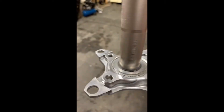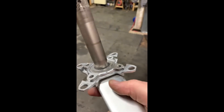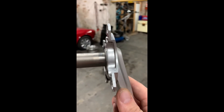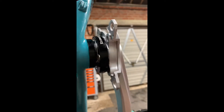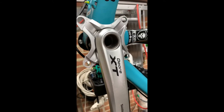All ground down now. Got a bit excited on that one and I'm hoping they're less than 1.5mm off — and it worked. Taking those tabs off, it just clears on all of them. I've ruined an XT crank, but there you go. Who wants a 2x or 3x these days anyway?